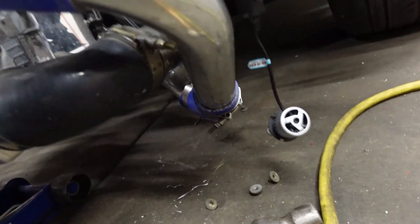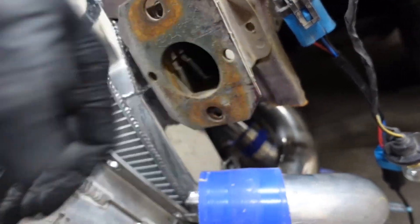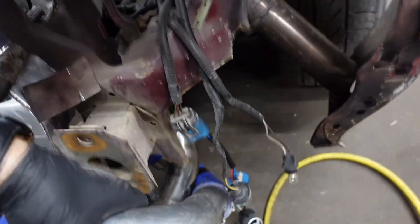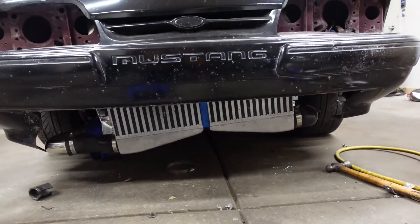Pretty much that is how it's going to be. It might be still too long, obviously — this is just mock-up. I kind of want to see if I can go through this hole right here, but the angle — I'd have to take this off, which is fine — it's just that would have to be a straight 90 here just to make that work into that hole. Or even just loop it around, because right now that's pretty much right there perfect sitting where it should. I just need to get a smaller connector or just a big one to make that work. Pretty much I just need an adapter there and an adapter there, and that way that'll be done. That's pretty much what the intercooler is going to look like if I kept this front bumper.